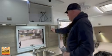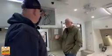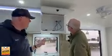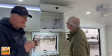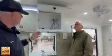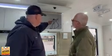Now with your power, we've plugged in your 12 volt power lead. So you can see up here, I'll clear out the way of the camera, there's your 12 volt lead. We've put that one in because we figure it doesn't matter whether you're at a powered site or not. That one will run 100% of the time. We've got your TV aerial, and you'll see you've got a black button here with a green light. That green light needs to be on to get signal from your TV aerial. That's like your booster or your amplifier.